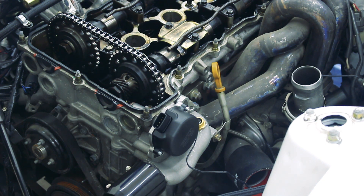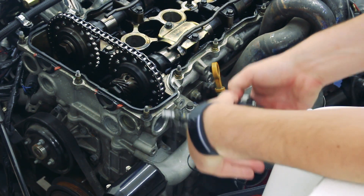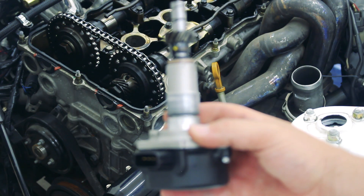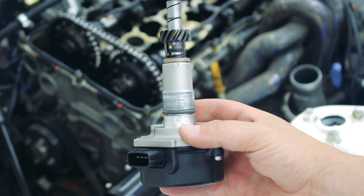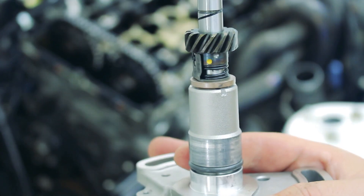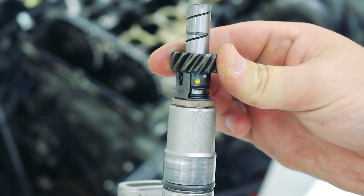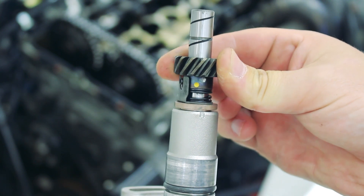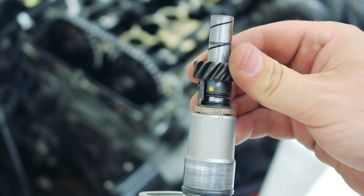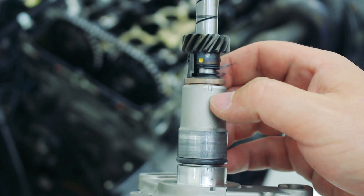Now that you have the CAS loose in the head, you can simply pull it directly out the side of the head and it will unmesh from the cam. As you can see, there are several dots on the CAS: a silver dot, a yellow dot, and a notch cut directly in the shaft. These three marks are used to align the CAS before it goes into the head, as well as guaranteeing proper alignment once in the head. Before inserting it, the silver dot should be aligned with the hash mark. Once that is done, you will be able to slide it into the hole and align it properly with the external mark.